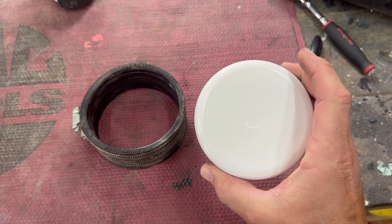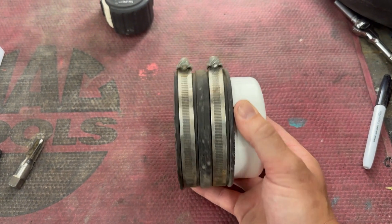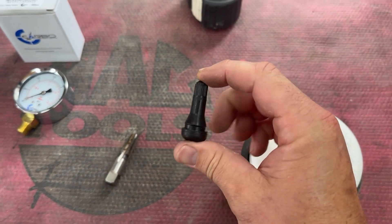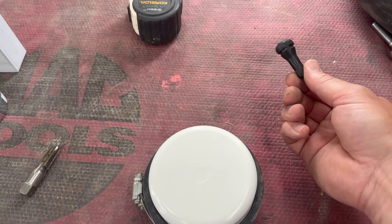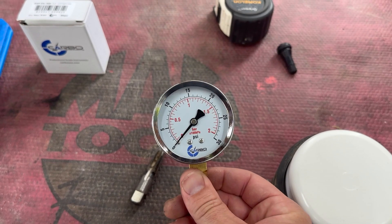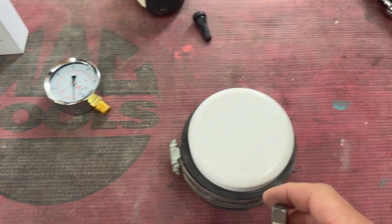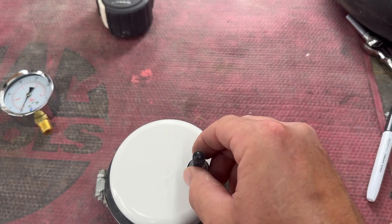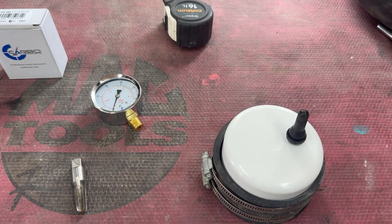Schedule 40 PVC cap — all we needed is exactly four inches, so it fits perfectly into my original air intake coupler. The other side will screw right onto the end of the turbo. What we're going to do is use just a regular valve stem — you can pick these up pretty much anywhere: tire stores, O'Reilly's, whatever. They're usually a buck or two. Then we picked up a low pressure gauge from Amazon, about $7 or $8. You're going to need a tap and a couple drills. All we're going to do is drill a hole and tap it, thread seal our gauge in, drill another hole and pull our valve stem through. Now we can put regulated pressure to it and pump the system up.